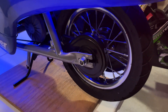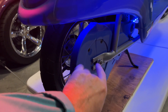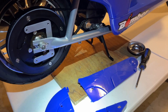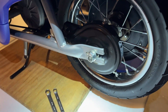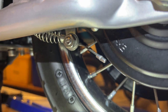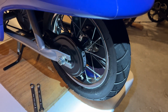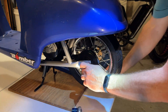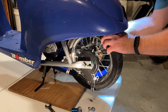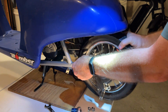To remove the rear wheel, I need a 15mm socket on one side and an additional 15mm socket on the other side. I'm going to first remove the chain guard using some Phillips head screws, and then remove the wheel. I got the cover removed from the chain guard and now I'm going to move over here and remove the drum brake using an 8mm socket, and then a 10mm socket to loosen the brake cable bolt, so when I loosen the axle bolts I can easily remove the wheel. Now move the chain off the sprocket, set it to the side, and then the wheel comes right out.